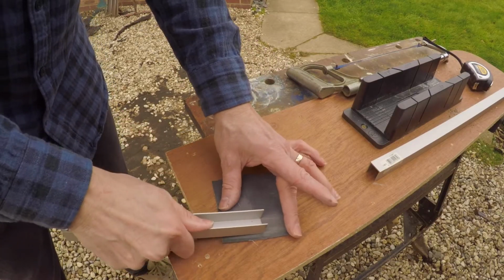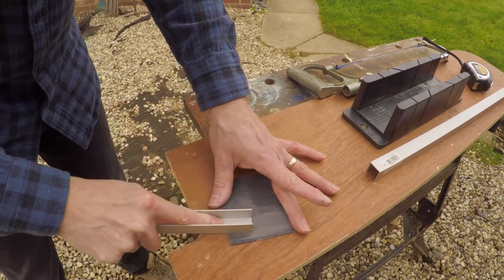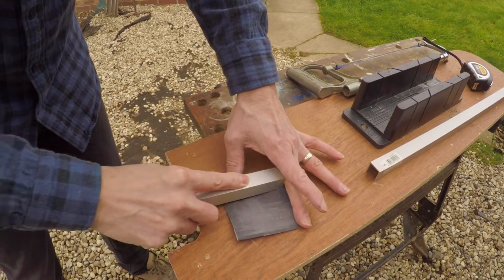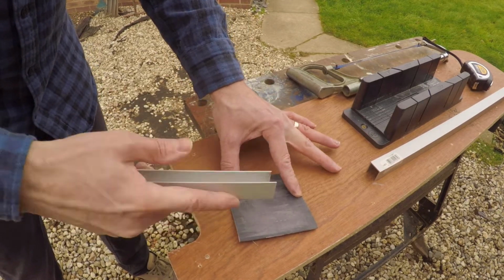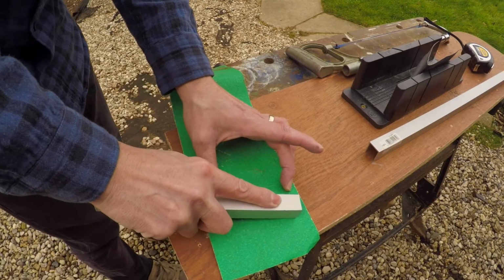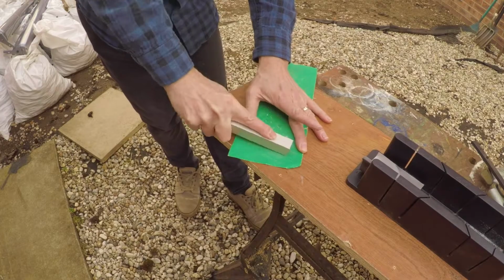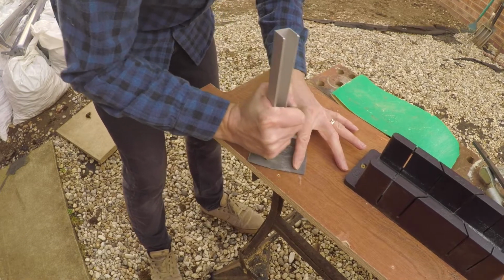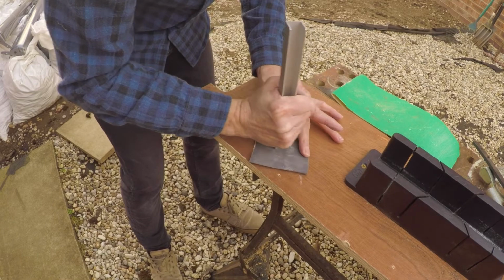When you do this, one thing you've got to be super careful of is you don't want any rough edges. You've got those chrome stanchions which go inside of the gas struts, and you don't want to mark them at all. Later on, you'll see what I do to combat this as well. I'm rounding off all the edges and making sure they're super smooth. I'm using quite a high grit sandpaper, smoothing them down with a really fine grit, so there's literally no burrs at all on these. This is quite an important step, I think.